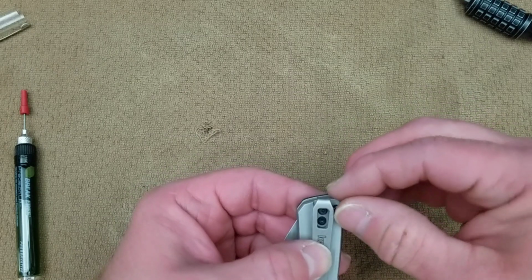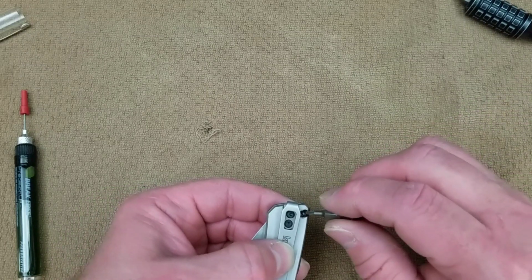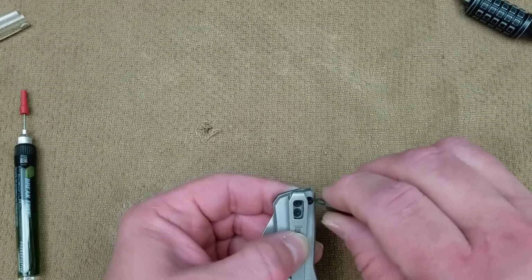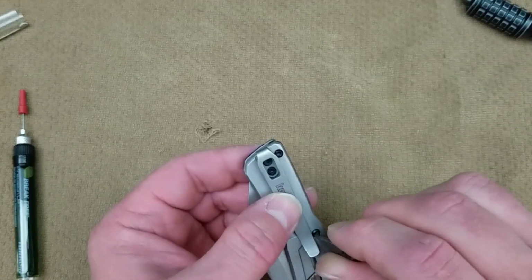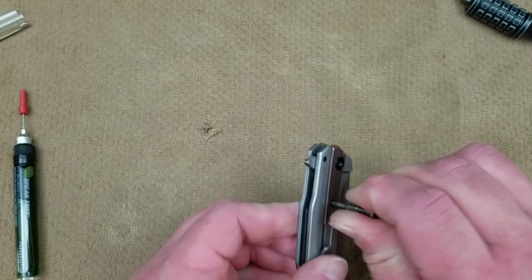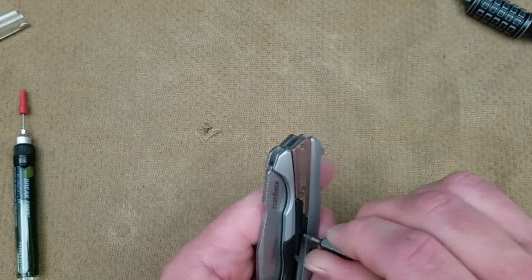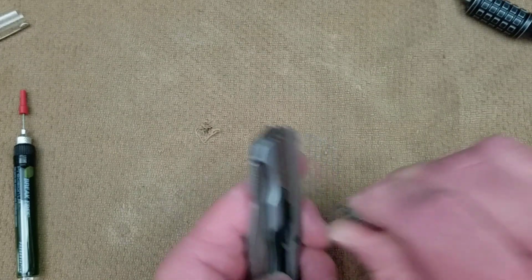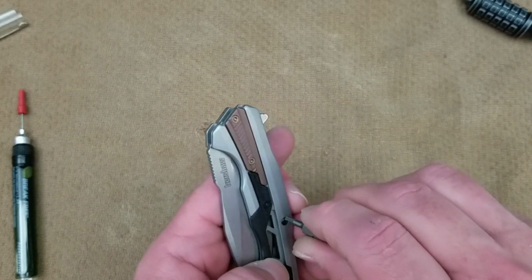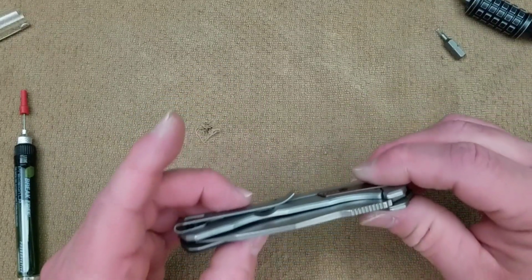And then we'll drop this screw in here if we can get it dropped down in there. Oh, come on. There we go. Always be careful with your T6 screws. I tighten T6 screws incrementally. It doesn't matter where they are or what they are doing. I always tighten them incrementally because little T6 screws only have so much contact area with the tool itself. It's easy to strip both the screw and your tool head. And I use Wiha Torx bits, arguably the best available, but you can still strip one out.